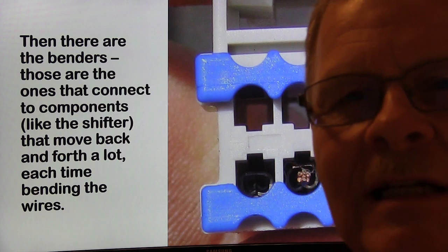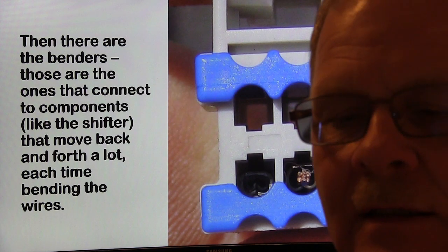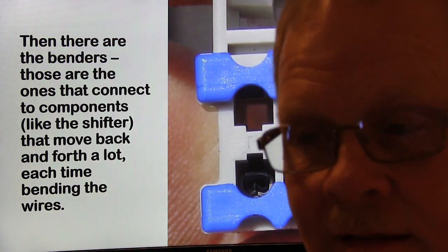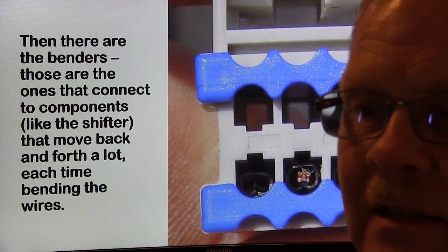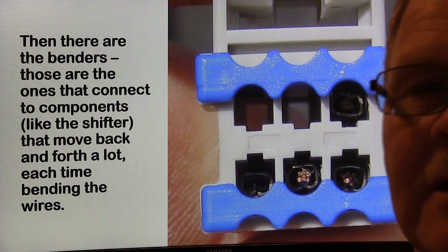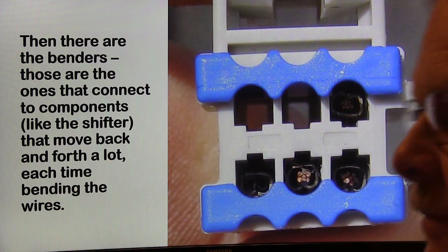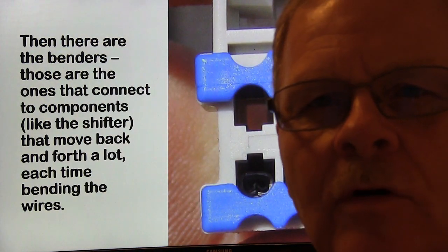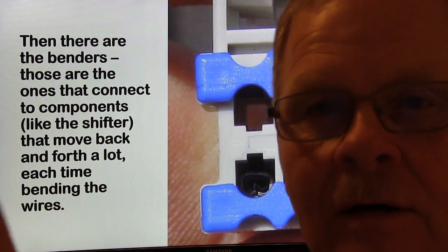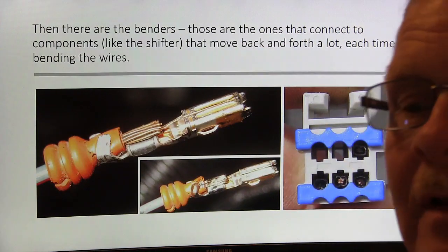Some of these that bend a lot — this particular wire connector was on an '06 Impala. The girl called me over and said her car was locked in park, couldn't put it in gear. First thing I did was make sure the stop lights worked, then plugged in the scan tool. The body controller gets the stop light signal, and I saw the signal was making it to the body controller. Getting to looking around, this little shift lock solenoid — every time she went back and forth in and out of park, it was bending those wires a little bit, and finally they broke off. Very similar to what I'd seen on older Ford stoplight switches, where bending the wire right at the switch would break it, and all of a sudden the car won't go in gear.